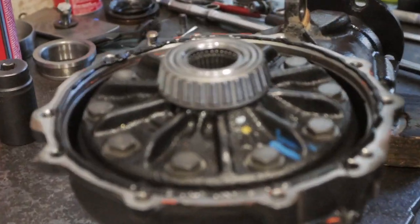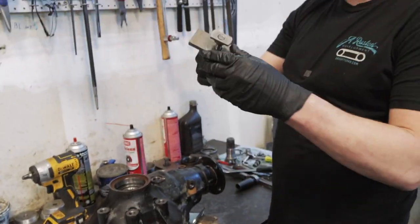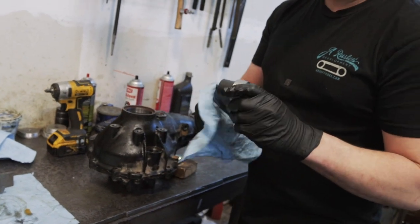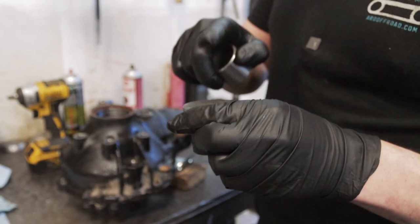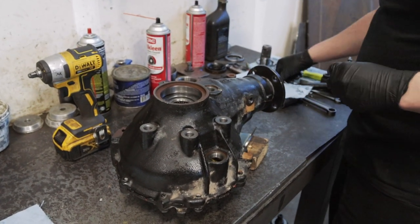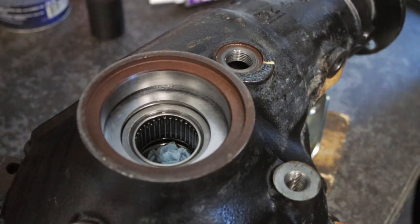It looks pretty even — that should be good. Make sure we've got no gaps; everything looks consistent all the way around. Now we're going to use the removal tool and some custom install tools — there's actually a gentleman in South Carolina who developed these, and this is the original prototype. To install the clamshell bushing, it's got a piece of Delrin mounted to it — that's plastic — and a metal cap you hammer in. First we've got to get the old needle bearing out. To avoid any metal debris falling into the diff, we're going to plug the hole below it.